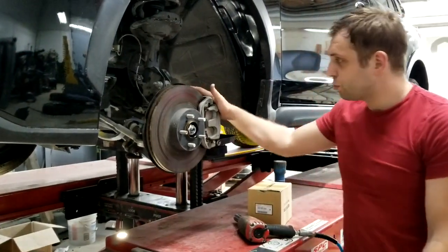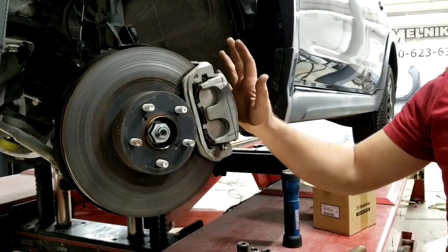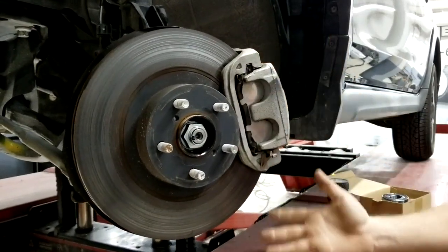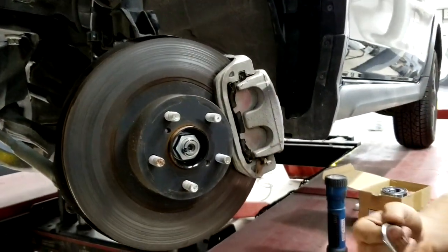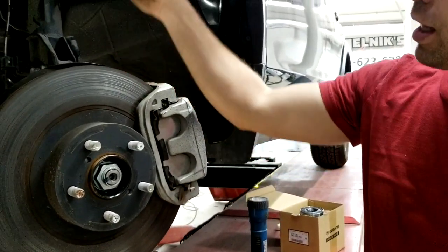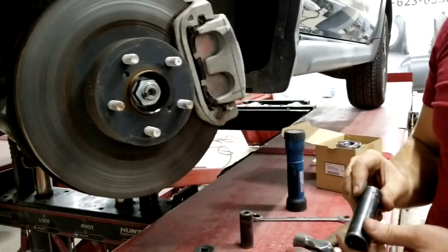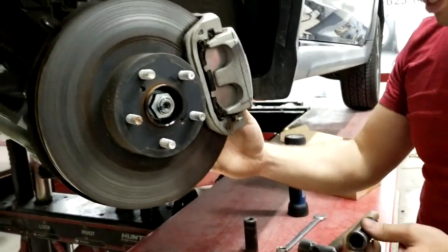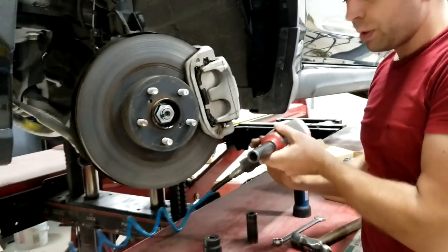Next I'm going to take off my brake caliper and then remove the axle nut. When you remove the brake caliper, you don't want to let it hang because you have a brake hose that you could damage. You can use a bungee cord — what I use is just an S-hook from the bungee cord. You're going to need a size 17 socket; you could also use an open-end wrench. There are two bolts on the back to take out. I'm going to use my impact — it makes it very easy and quick.